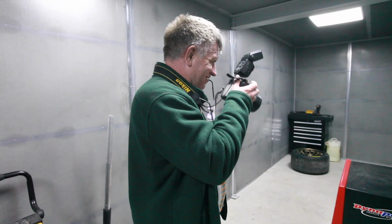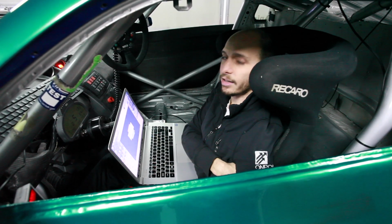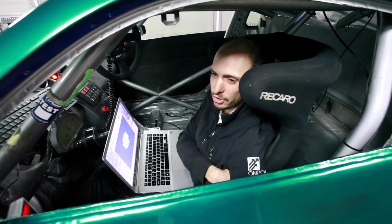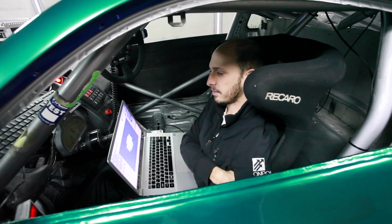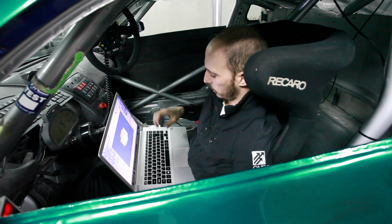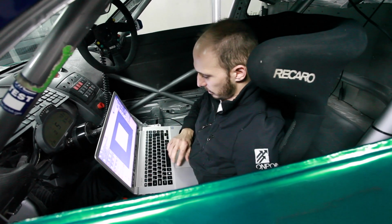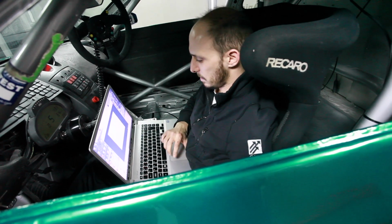And that's Frank from Moto IQ. So the engine's actually pretty stock. It was a junkyard HR motor. That's right. And it's got high compression pistons that Jim Wolf designed from JE. Jim Wolf, big cams, valve springs. Heads are stock, rods are stock. It's got a 370Z crank, so it's a 3.7 liter engine now. Yeah. It's pretty simple, really. Then it's got our throttle bodies and our headers that we made at SG in like 2009.